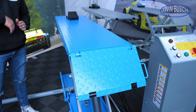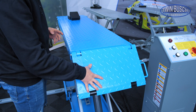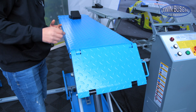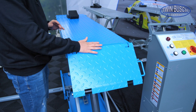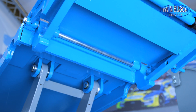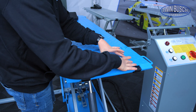Another big advantage of this type of scissor lift is the vehicle reception. Here we have the access ramps, which also work as an extension. If I have lowered the lift completely, I can use them as access ramps. But when my car is already placed and it's a bit longer, I can raise them. They lock themselves down here at the same time, and then I can place my rubber pad here for longer vehicles.